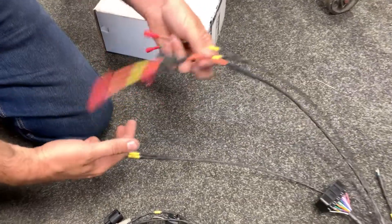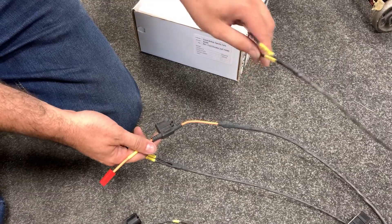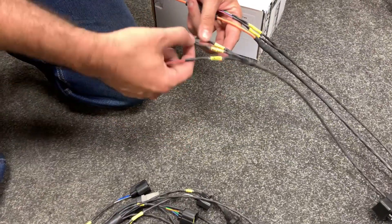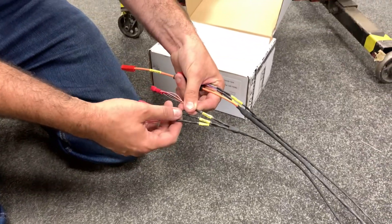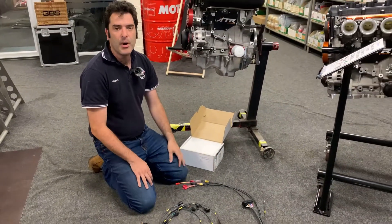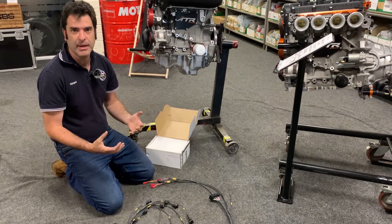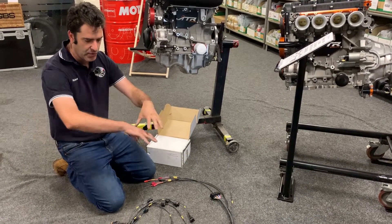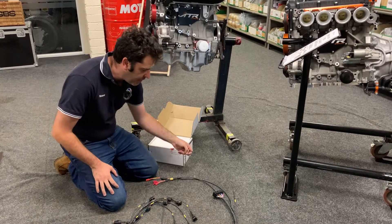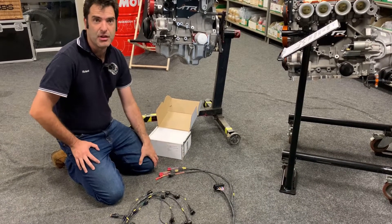You have your power supply, two relays for your fan relay and your fuel pump relay. You've got your tacho output, your alternator output and your oil gauge output. The idea is that if you've got an old Mk1 with a Pinto or crossflow in, you've typically got your distributor wiring and that's about it. You can pull all that out — this will replace all the original engine loom and run everything on the engine, with very few connections to connect up to it, making it a simple installation. You could almost run it on the bench on a battery if you wanted to.